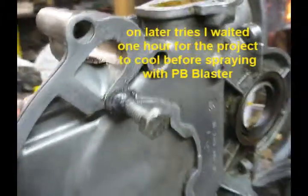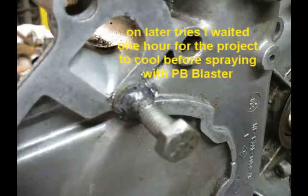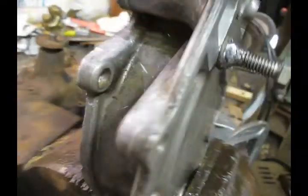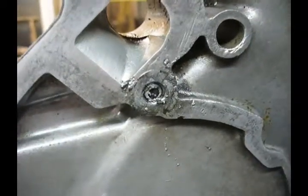In case anybody's interested, I used a 3/32 size welding rod. It's about all my little buzz box can handle. It's a 6011 rod. In this case here, you can see the bolt hole actually goes all the way through, although I do not have a straight shot at it from the back end. So I squirted some liquid wrench in there, or PB Blaster, and got this bolt welded on. Now I'm going to try to twist it off of there. Okay, it didn't work.